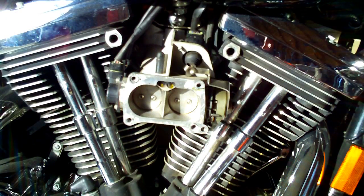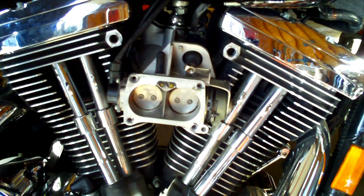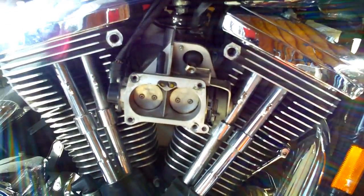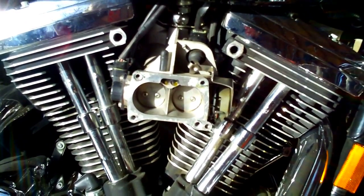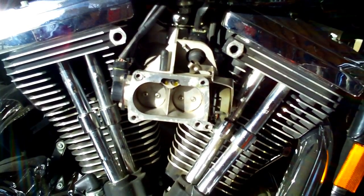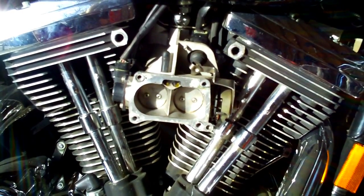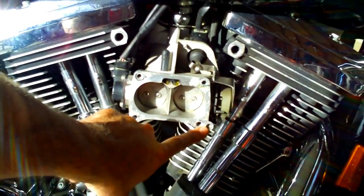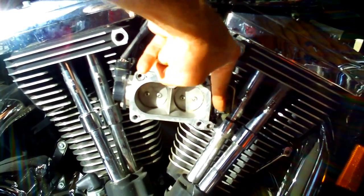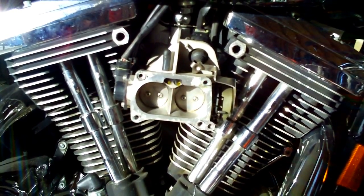Everything's clear of the bike — all the tools, wires from the tester and such. Let's go ahead and power it up in neutral. Engine light is on... engine light just went out. Let's fire it up. As you can hear, the cold idle motor is keeping the idle in check. I turned the warm idle screw back in — I had turned it out two turns, so I turned it back in two turns, so it should be right where I had it before. The warm idle screw is down here, the cold idle screw is in the back on this rotating band. They're both Allen hex screws — I believe it's a 2.5 millimeter wrench that fits those.